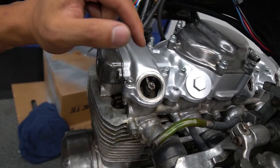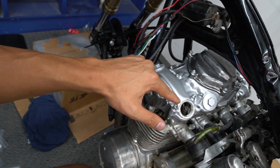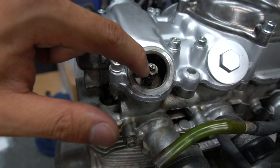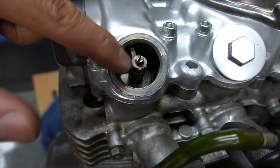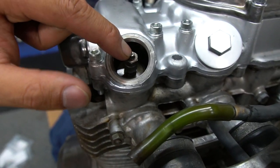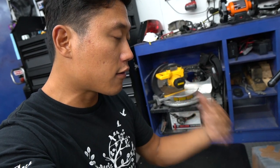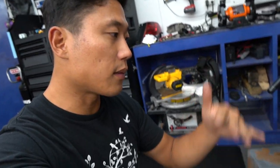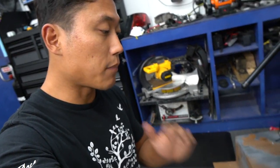It's a four-cylinder engine - cylinders one, two, three, four. You've got the intake and exhaust valves over here and then your cam going across horizontally. What I want to show you before I close this up is the valve tension adjustment. By releasing this hex nut and spinning this bolt, you can adjust the height of these rocking arms that hit against the valve. What you need to do is spin the crank - at top dead center TDC, you adjust cylinder number one, then spin it more for cylinder number two, and so on. I haven't looked at the owner's manual in detail for valve clearance because I know this bike doesn't need that right now.